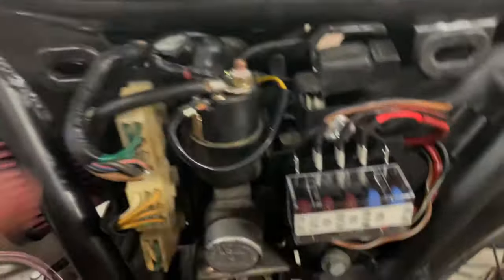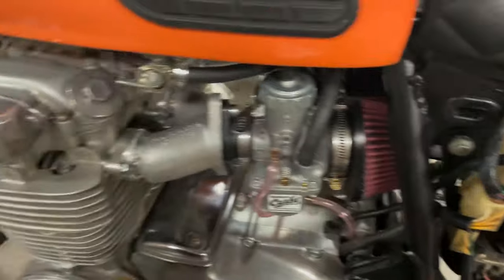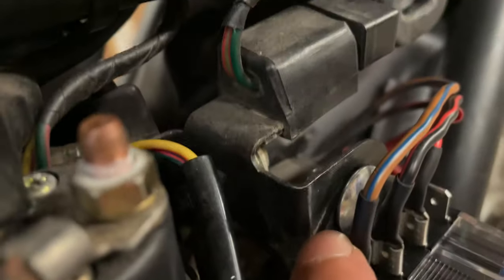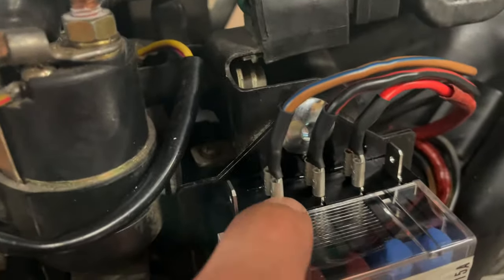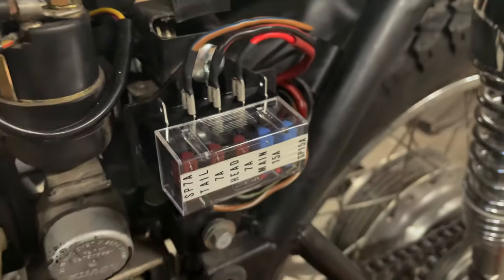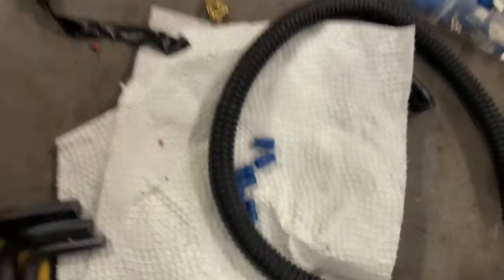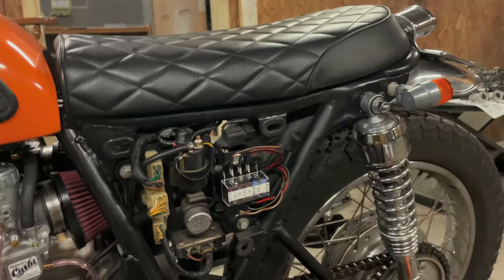I've got everything mostly done here. I already hooked the battery up and tested it — the headlight and taillight are working, which means the main fuse is working. I then disconnected the battery. I used some nice flush-style Allen head bolts to replace the original 10mm bolts so they wouldn't interfere with the female spade terminal. I'm also going to put a little heat shrink on the ends of these female spade connectors so I don't have to worry about them shorting out on that grounded bolt for the headlamp fuse. I'll also put some sheathing on the wiring — going with a smaller size since it's only a small amount of wires.